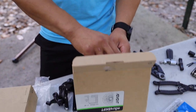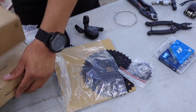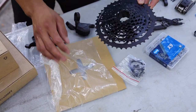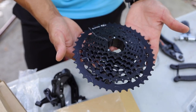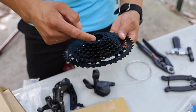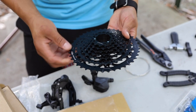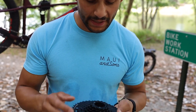This is the 11 to 42 tooth cassette. The cassette that is on the Mongoose right now - the freehub - is a 14 to 38 tooth, so we'll definitely have a little bit more climbing power and a little bit of top end speed. We're gonna see how it does on the Cat's Meow here shortly. That thing's nice - not a lot of weight to it. It feels like it's aluminum and I think that's steel on the biggest cog. That's the official scientific test right there.